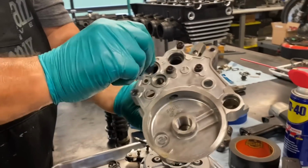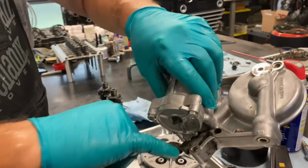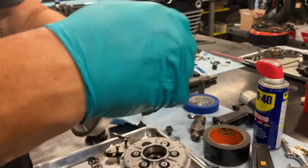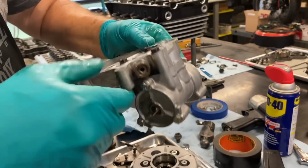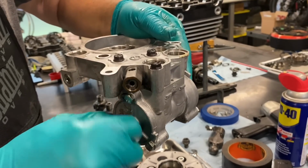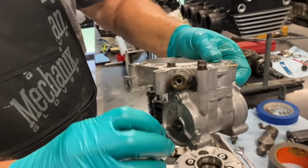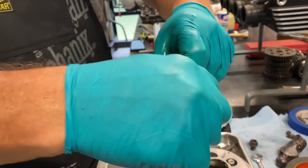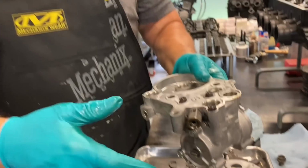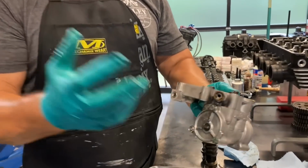when you put your oil pump in, you have one of the bolts that goes through and holds it. This section, if you look down in there, is stepped, and there should be a dowel in there that locates it. When it's lined up, you need it lined up really precisely, because there are engagement points for this side of the pump and this side of the pump. One is driven off the clutch in a gear that turns the pump, and the other end drives your water pump. So you don't want this thing moving around even a couple thousandths of an inch in there. You want perfect alignment, and without the dowels in, that's a bad deal.